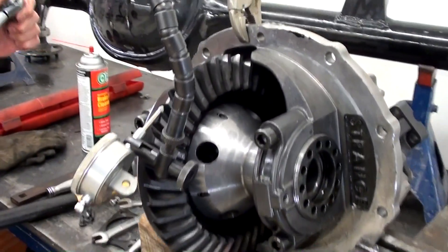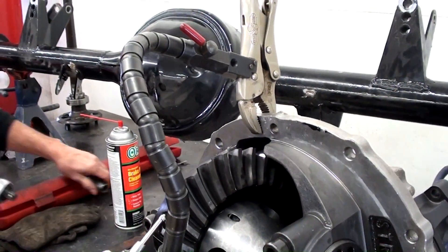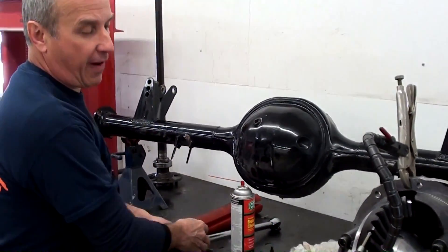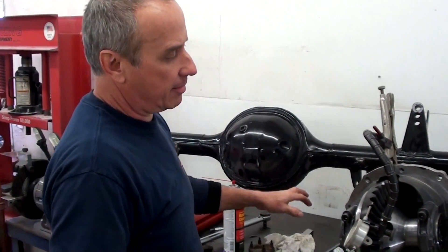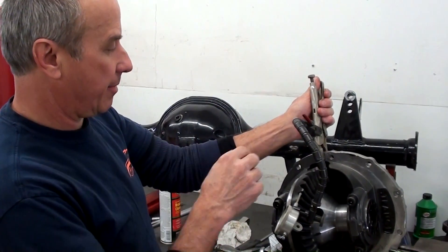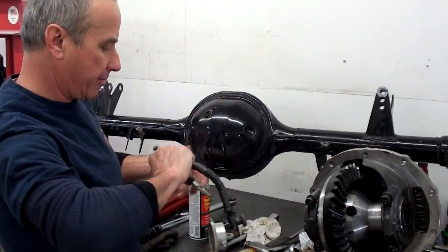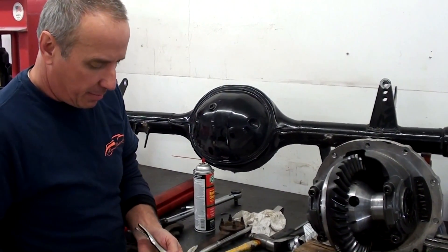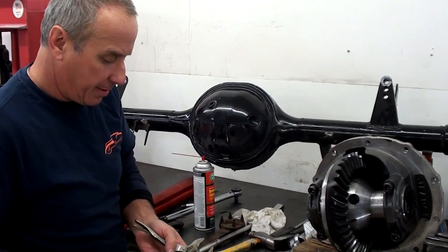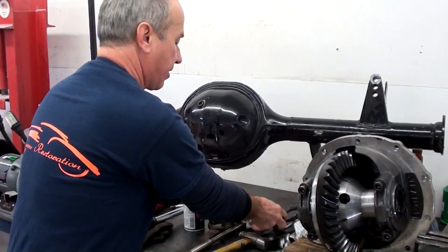When these are finally assembled, do you take the grease, run the pinion in there and see how the pattern looks? I'm going to do a final on it. We had done a set on this and we were just closing the backlash up on it a little bit — it was a little bit wider and we wanted to close it up, but our pattern was always pretty good. This will give us a little more depth. So I'm going to go get the grease and do a pattern on it, make sure I'm happy with the final, but we should be right there.